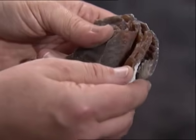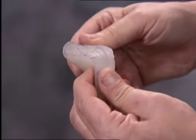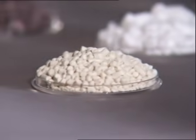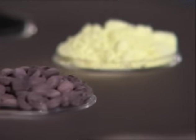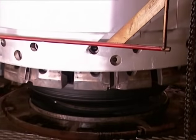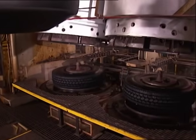Treads are often a blend of natural and synthetic rubber because each has unique, desirable performance characteristics. Different additives, polymers, and other components provide strength and resiliency, along with resistance to wear and heat. All are combined, then cured in molds at high temperatures, changing the materials, bonding them together chemically, and forming the tread.